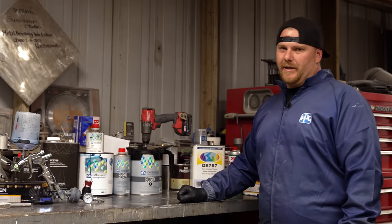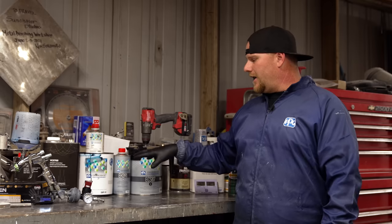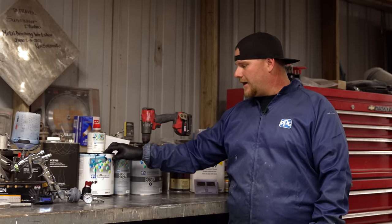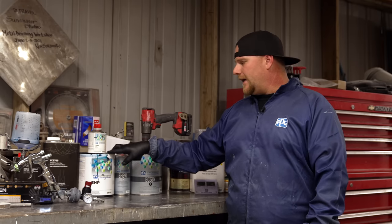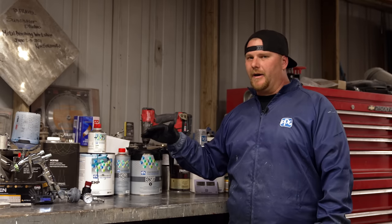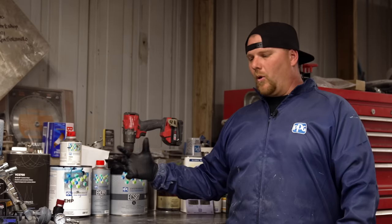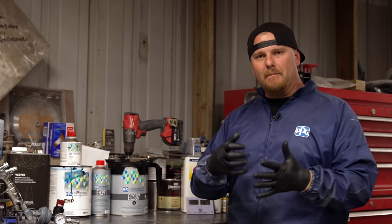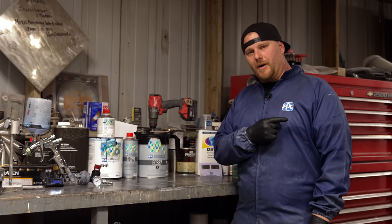And going back to why do we seal? Well, we finish the car off with 600 grit wet sandpaper. The color that we're going to be shooting today is going to be a high pearl content. There's a lot of pearl in this color. It is a Chrysler 300 metallic blue, and it has a lot of blue pearl. So I like to go at a minimum 600 to 800 grit to be able to shoot everything over. Now we're gonna seal because we're putting the sealer into our 600 grit scratch, and that's where we're getting our adhesion mechanically from our VP2050 epoxy high build, which is what is on the car right now.